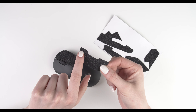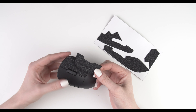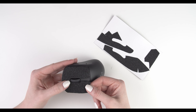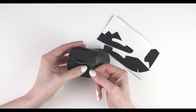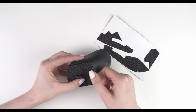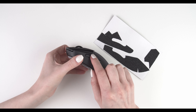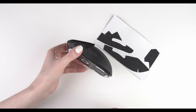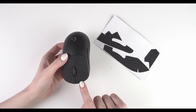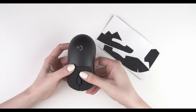Carry on with the next mouse button part. Take it — it's exactly the same process. You align this straight line of the grip with the inner part of your mouse button. This curve should fit. Press it down gently, watching for this curve and the bottom line. Align this side of the grip, then press it down from the front to the back side of the mouse.